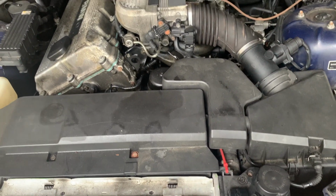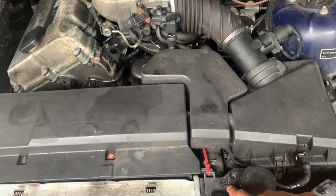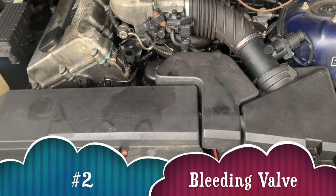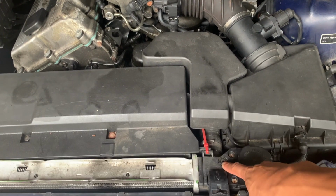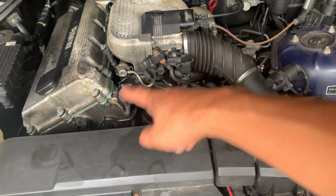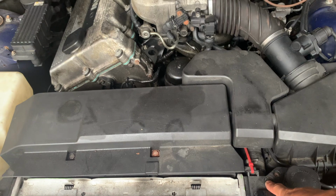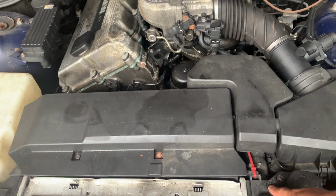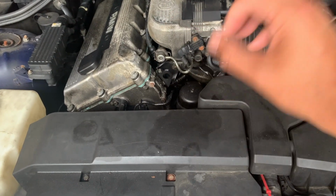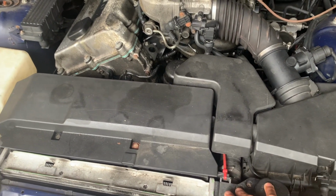But what I've noticed is from time to time, I have air in my system. So at times when you're running, especially if you're running more than 5 or 10 minutes, possibly even 15-20 minutes, open this up a little bit. Don't open it up fast, okay? The breather valve. What that allows me to do, at least for my car, is that any air that gets trapped inside the system gets out, and then I drive good for a while. Unfortunately, it all comes back, and then I still have air in my system. So I still need to figure out the ultimate culprit, but at least I've got workarounds. Those are the two things right off the bat when it comes to the coolant side, okay?